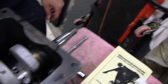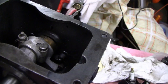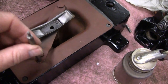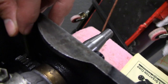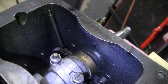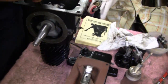I got the connecting rod connected. Turn it up there — I want to show them something. Most of the engines have slingers on them, and this one doesn't because they have this oil pump. It's run by the cam — that copper-gold thing. The pin that goes right here — the pin goes in there, and then when it spins, this goes up and down, pushes this, and then oil comes squirting out the middle there. Fill this with oil. So that's why they don't need slingers — it squirts up in there.